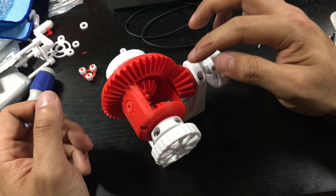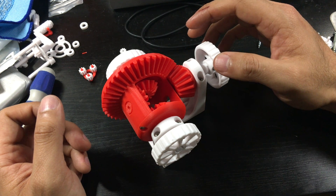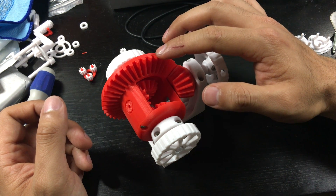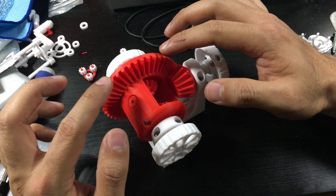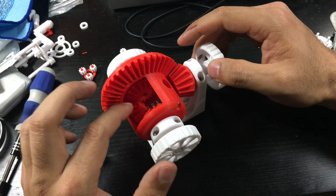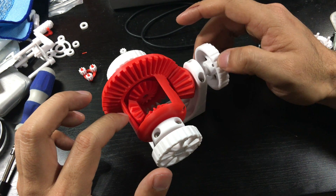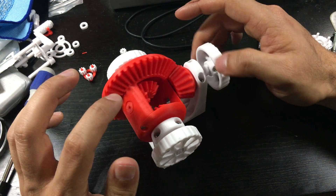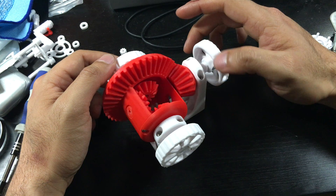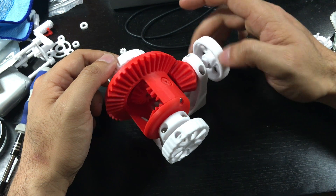The way this works is, there's something called a pinion gear — and excuse my bloody hand, 3D printing can get messy. There's this little pinion gear and it is connected to this other gear here. That gear has a little side wall, and in this little side wall there is another gear that's just free flowing — there's actually no power going to it. But when both wheels are in motion, it doesn't even move. However, when one wheel gets stuck or goes a little bit slower, it allows skipping around that gear.